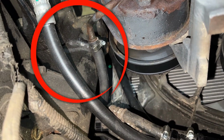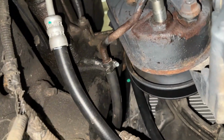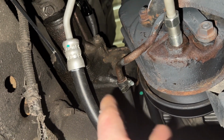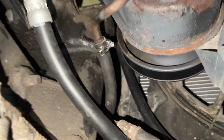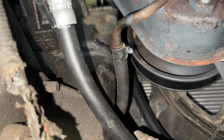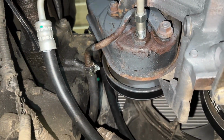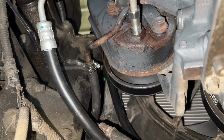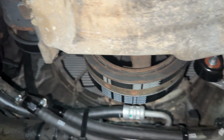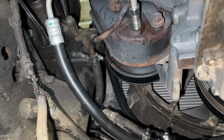Low pressure port, you gotta tweak that a little bit. That is not where it comes out of that box from the factory. You gotta bend it a little bit this way and then down a little bit to get it to fit right in there, but she just sneaks right around the gearbox once you get a little bend in her. You gotta be real careful when you bend them. There's a lot of tricks to bending them, i.e. put a set of vice grips on the tube and then bend it, that way it doesn't crush. I'm not gonna get into all that, but the short version is correctly bend your power steering return line so it clears that gearbox and you are off and running.